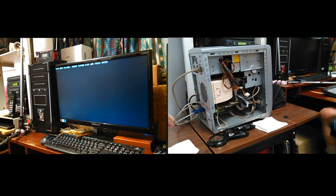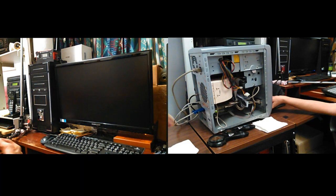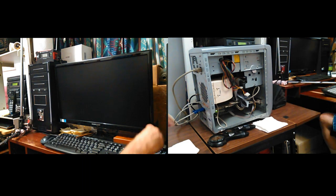Well, I might want to get my, oh, actually, I've got that USB stick in it. Well, it's not recognizing it. I don't think some machines will recognize it. This one won't because I looked in the BIOS. Some of them will recognize USB sticks, but not the SD cards in the USB adapter. But I heard the hard drive make a little bit of a normal noise, so I thought maybe it's reading the hard drive. I switched to the other power cable too. But I want to take my tester and make sure it's getting the right voltage. So I'm going to turn it on again.